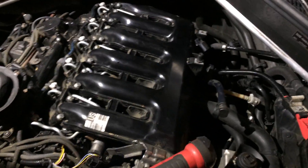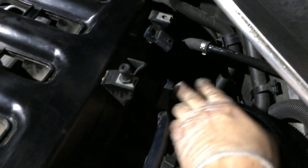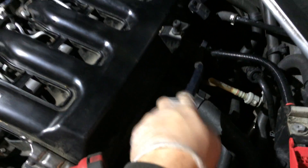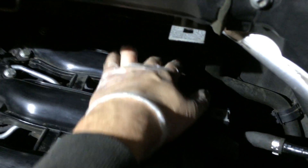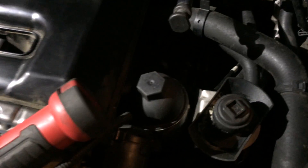I'll quickly show you how to check and take the intake manifold off. It's not that hard. There's one bolt here, one number ten holding the transmission lever, and number eleven bolts — one, two, three, four, five, six, seven, one at the back — and a number ten here. You also have to disconnect everything from the throttle and turbo.